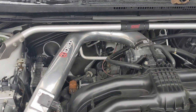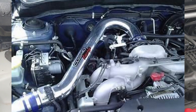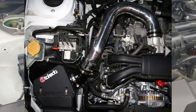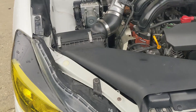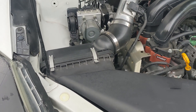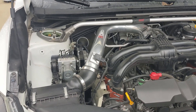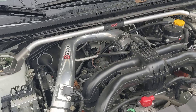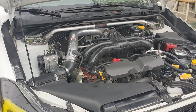You can use different types of pipe. If you find another kit from naturally aspirated Imprezas, Foresters, or Outbacks from EJs, those pipes all kind of fit to this area where the airbox is. A lot of those aftermarket ones, if you're okay with finding the fittings for them, you can build any kind of hybrid intake you would like.